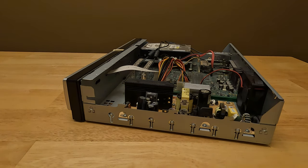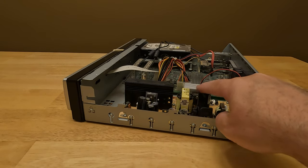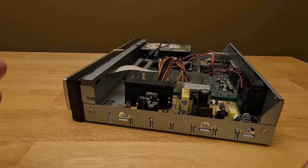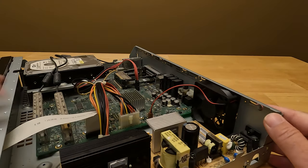I've been in here before because I had to replace these capacitors — maybe six or seven years ago they were all bowed out on the tops and the device wouldn't power up. So I replaced the capacitors on the power supply, all the ones that were bowed. Very inexpensive, maybe around twenty dollars of parts.